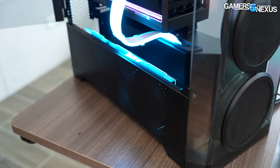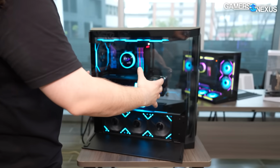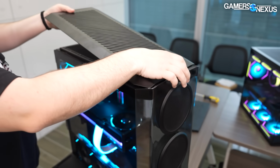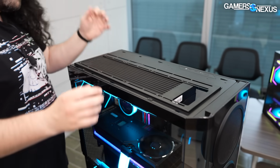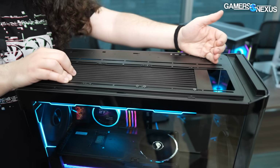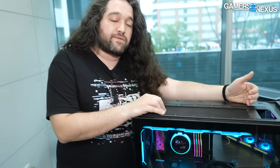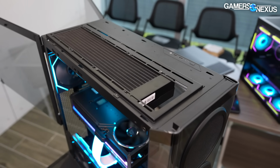So that's one upside. He thinks maybe from a look standpoint, it might improve as well, just kind of tightening everything up. And then the only downside would be, and you can sound off in the comments how much you care about this, because he actually did read the comments last time, maybe to his own detriment, depending on what you all post. But this currently supports a 420, and shortening it would eliminate that. It would come down to a 360 for the max radiator support, and that's really the only major trade-off. So you can talk about that in the comments.